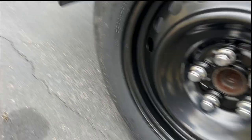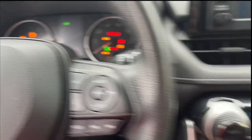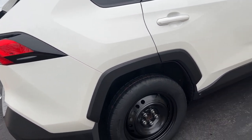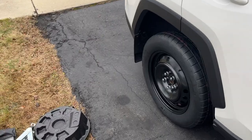That's how you change the tire. Go around the car, collect all your equipment, get the triangles out of the way, and remove your electronic brake. To release the e-brake, hold the brake pedal and push the lever down — the e-brake is removed. If it's the rear tire, make sure the jack goes at the rear. If it's the front, put the jack at the front. Don't forget your e-brake and the block under the tire.